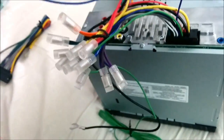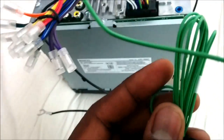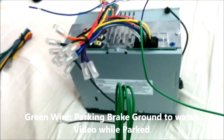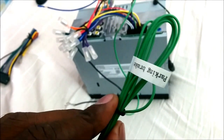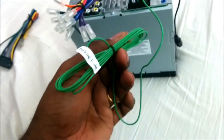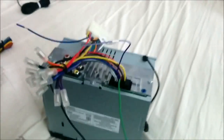There's also a separate green wire on this system labeled 'parking brake.' If you have a DVD player built into the unit and want to watch movies, this wire has to be hooked up to the parking brake switch as a safety system so you can't watch DVD while driving. On some units, grounding this wire will work; on others, you actually have to provide a 12-volt signal to it.